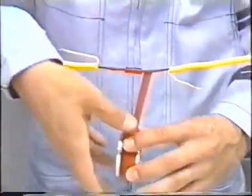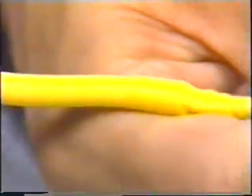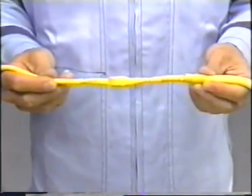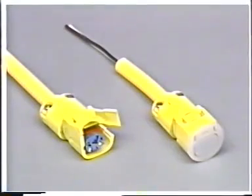First, thoroughly wind the silicone tape over the connection. Then, wind the taped connection with ordinary electrical tape. If the connector is damaged, as seen on the left, replace it with the new one as seen on the right. When this is done, check the diagnostic code again. Code 41 is displayed. This code indicates an old trouble.